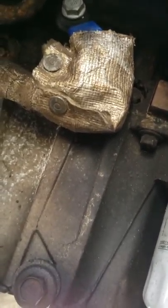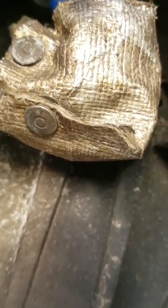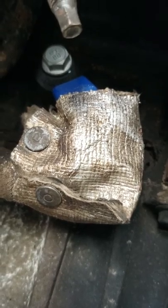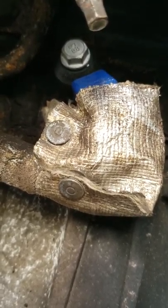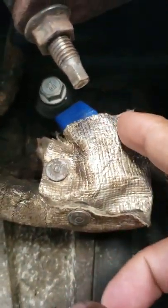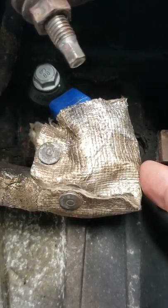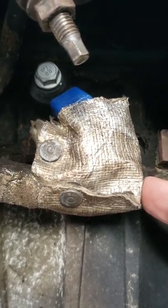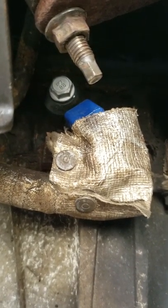I found them right here. There's a connection — you'll see an elbow with that heat-shield material that prevents heat from the block from getting into the sensor and damaging it. It's a 13 millimeter socket to remove it. When I took it out I had a problem because the heat shield here wasn't doing its job — it feels like it should have been a little bit higher to cover the end of the sensor.